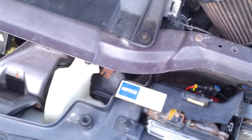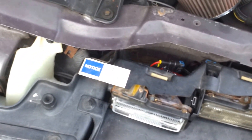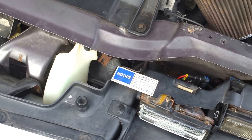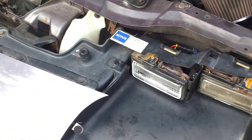Put your HID bulb in — I used a 9006 HID bulb — then silicone it in carefully. You can't touch the bulb and you cannot get any silicone on it. I paid $55 for my HID kit off Amazon, supposed to be 55 watt, but it's just a 55 watt ballast with a 35 watt bulb.